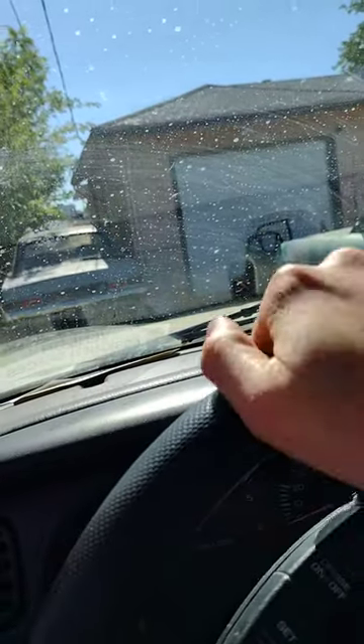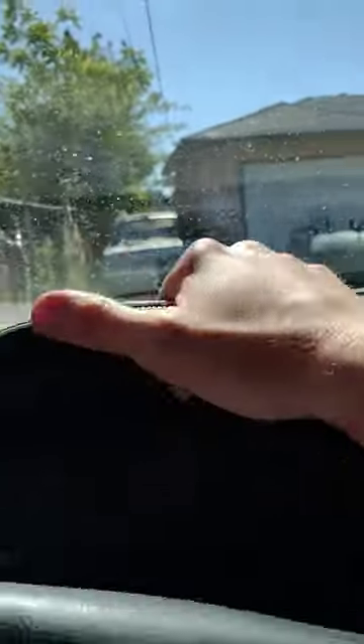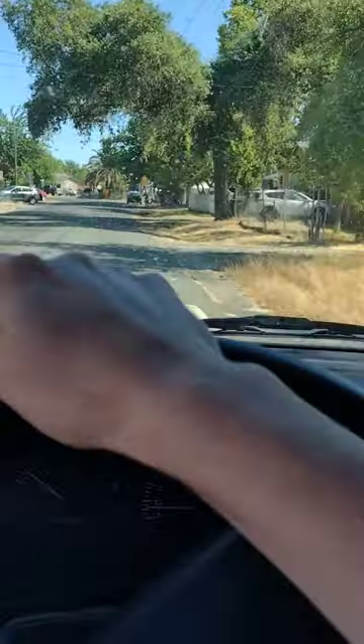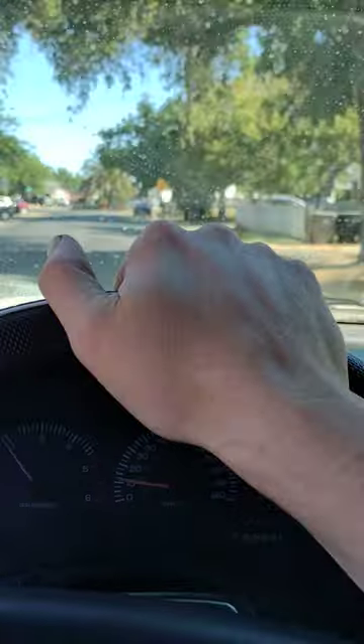It's actually working much, much better than I thought it would. So we'll go around the block once and see if it sounds okay. I also found out that I had a pretty big vacuum leak. The vacuum leak was one of the vacuum doodads off the side of the intake manifold, which wasn't even there. Actually, it's running pretty good — kind of surprised.